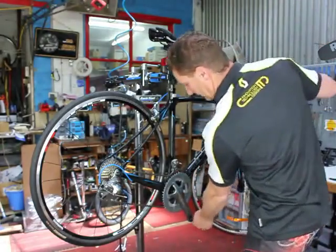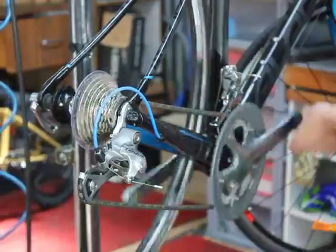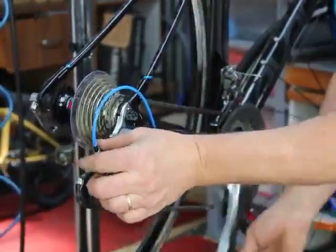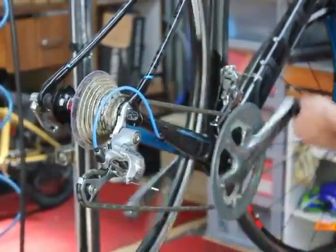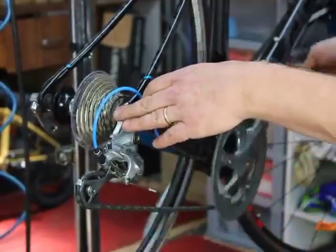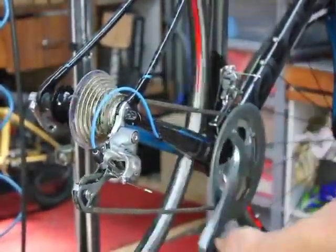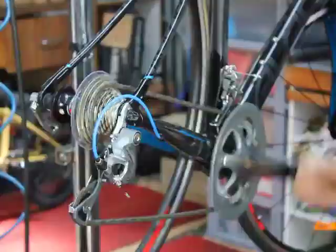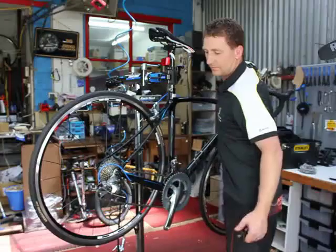Then twist and set there. Whilst turning your crank, just one shift of the gears — and as you can see, nothing happened, it didn't go up. Use the cable tension adjuster on the back of the derailleur, anti-clockwise until it jumps up onto the second cog. Drop back down to the smallest gear and repeat to make sure it goes back up. Wind the cable adjuster until you hear it starting to want to go up into the third cog, then come back one and a half turns. Then we should have a full range of gears up and down the cassette. That's rear derailleur adjustment.